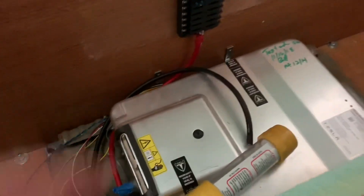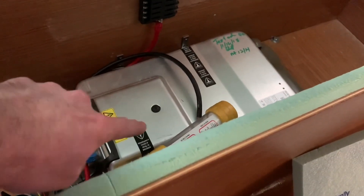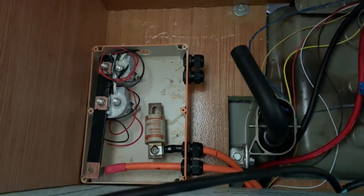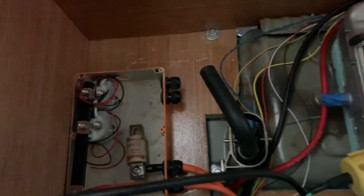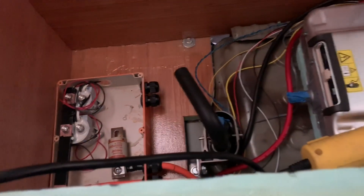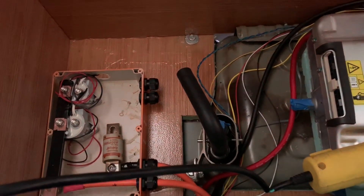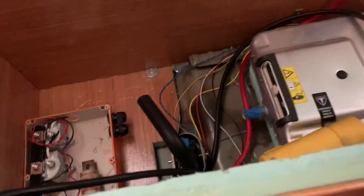I can't finish that until I have the board. I've got all the wires run that I need — I have one battery terminal connected here, but I ran out of crimp connectors for the ground. I've got this pretty much done except I don't have a nut and bolt for it. You can see where the cable gland is going to go, just waiting on that to show up. Then out here the cable goes to the front of the car, but I don't want to cut and put that wire in yet — I want to review everything and make sure placement is exactly right. And I also don't want to drill through until the fiberglass is wrapped around the whole trailer.